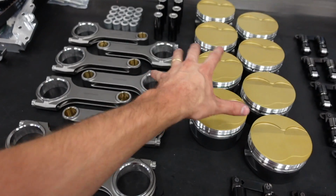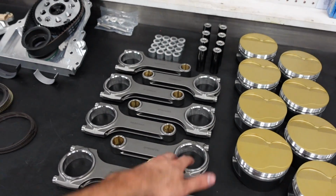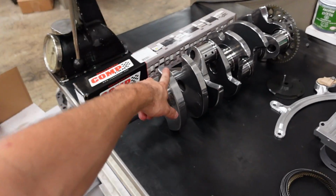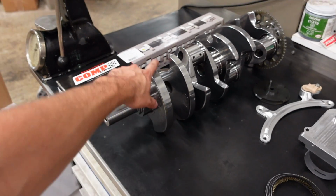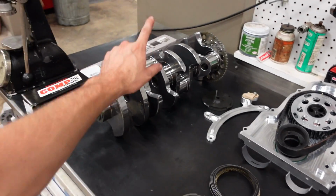So these kind of get made in synchrony actually, but once everything is done, you then have what's called a bob weight. And then you call Sonny Bryant and you tell them, hey, Mr. Sonny Bryant, I need a 3,000 horsepower LS crankshaft. And he'll say, cool, we can do that. What is your bob weight?